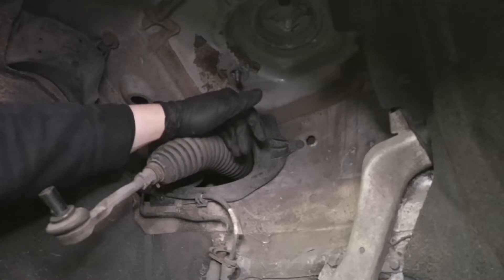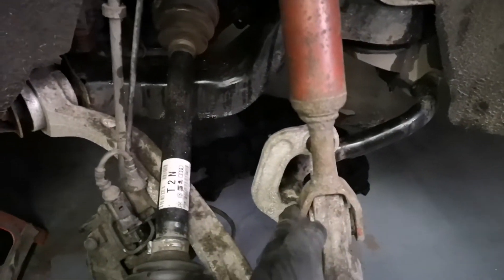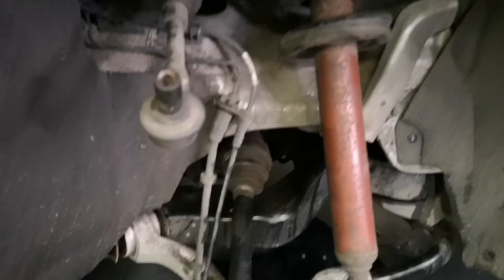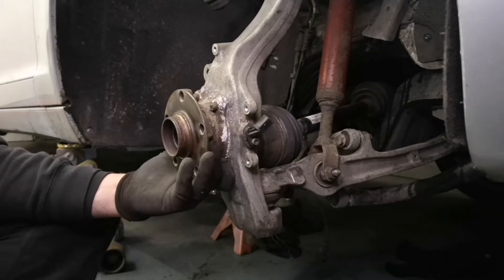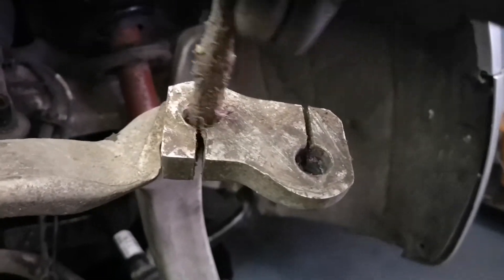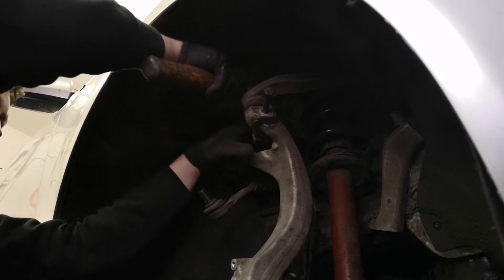I'm a little bit disillusioned with the car. I'm going to build it back up and go for a road test and see if there's any difference, but I very much doubt there will be. Strut is now in — time to put the clamp bolt in, connect all the ball joints back up, brakes back on, and it's ready for a road test. A little bit fiddly to get these in as there's quite a lot of stuff to line up; however, persistence pays off and you get there in the end. I'll put a little bit more copper grease in these — it's not the kind of thing you want to seize up.